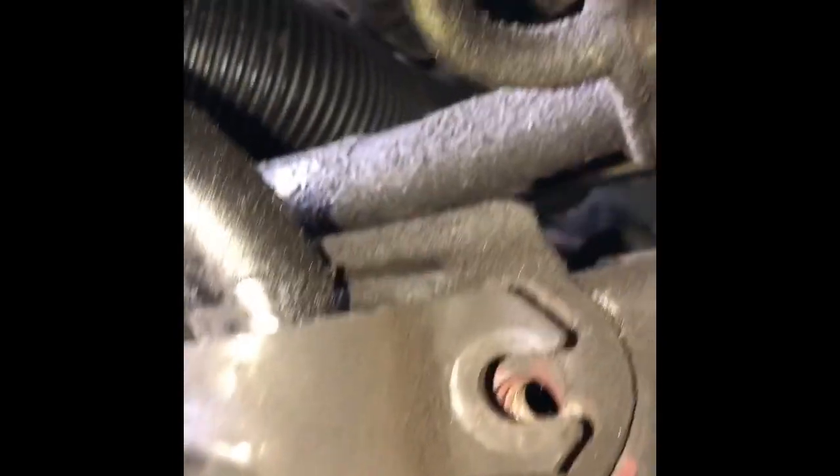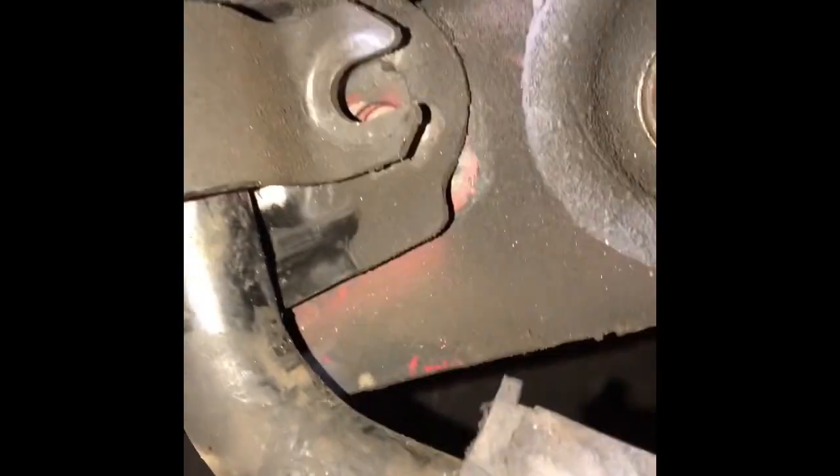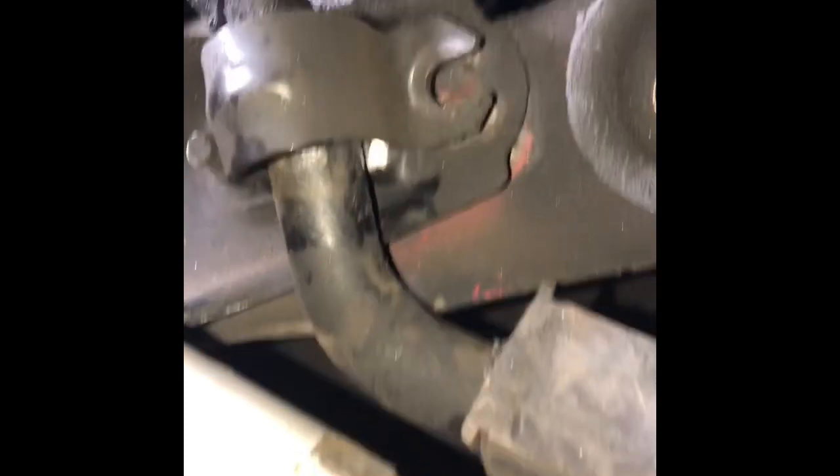Caught in the sides of that video is my sway bar — the bushing has just ejected itself, it's now hanging out over the middle of the bar, and the other mounting bolt also kind of left the building. I assume that's probably related to that bolt having come loose, probably strained the hell out of it and just rattled itself loose or snapped off. Doesn't look like there's anything left in there, which is lucky I guess. Going to try and straighten this whole situation out and slap another bolt in, call it good.